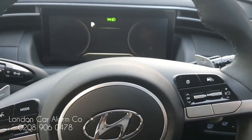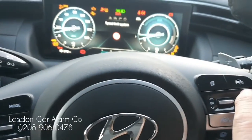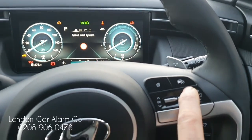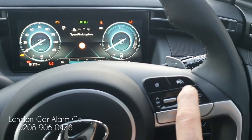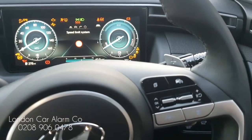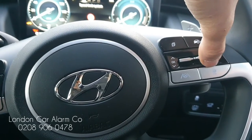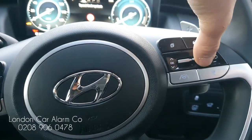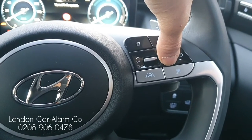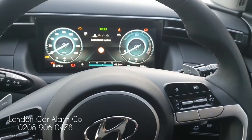We're going to keep it very basic. So let's turn the main ignition on, disarm the system — one, two, three — receive our melody. Then hit one of the buttons on the network five times: one, two, three, four, five. Start button off, then back onto main ignition, and we receive five bleeps. So now I'm just going to do — for video purposes — up: one, two, three, receive our confirmation. Repeat: one, two, three, wait for our confirmation again, and the code will be learned.